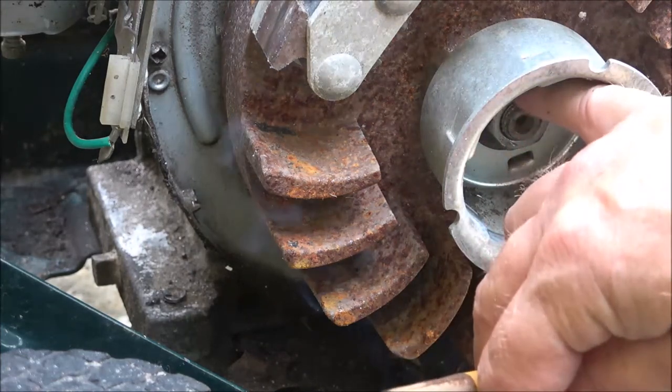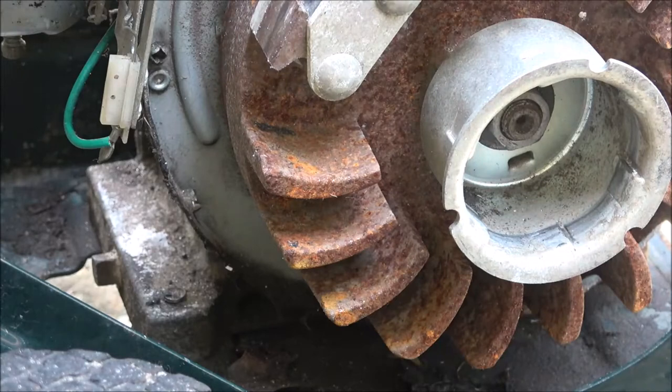Inside of here, there's a shear key, not a shear pin. You know, a lot of guys call it different, even professionals. They'll call them shear pins. They're not a pin. A pin goes in a round hole. Then they'll call cotter pins cotter keys. They're not cotter keys, you know. It's like, it might be your shear pin or your cotter key. You got that backwards, okay? So, because there's a keyway in here, that's why it's called a key. It's actually called a Woodruff key.